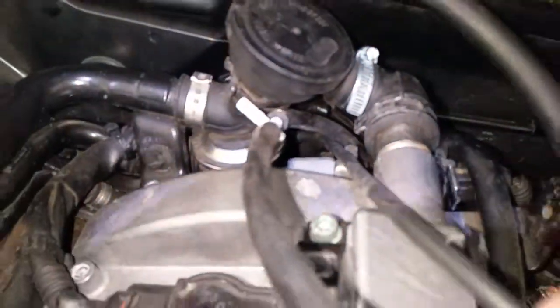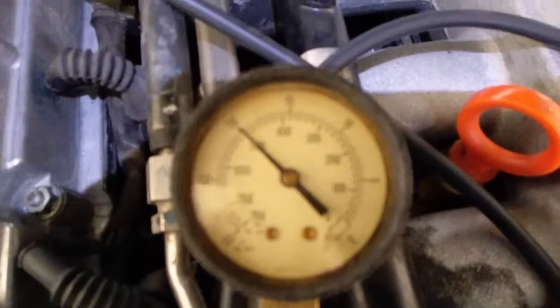Here I have a vacuum line coming from the combination valve. I have 20 inches of mercury vacuum applied to it, so it should be open. I have the hose from the pump unhooked, so in theory I should be able to just blow air right through it — but it is not flowing.